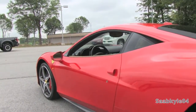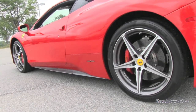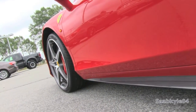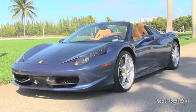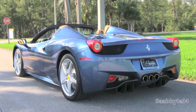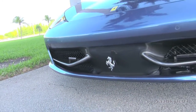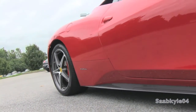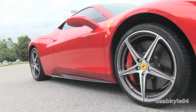The aluminum chassis is all new, benefiting from a 15% increase in torsional rigidity and 5% in beam stiffness, thanks to new aluminum alloys and bonding techniques without adding unnecessary weight. The front clip of the 458 is dominated by a large opening that hides two large air intakes that help channel air to the engine. Dividing each intake are two aeroelastic winglets designed to deflect downward as much as 0.8 inches, helping generate downforce, in addition to further channeling air to the radiators for improved cooling.